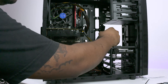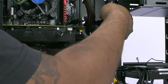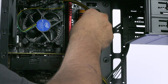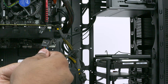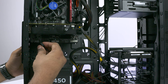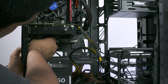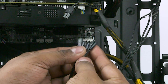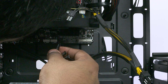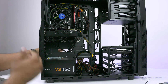We're going to connect the case cables now. First, the USB 3.0 cable — plug it into the USB 3.0 header on the motherboard, which is right below the 24-pin socket. Then plug the HD audio connector in. Next, we've got a bunch of smaller cables for power, reset, hard disk LED, and so on. Route them through the back — remember, the ones with the triangle are positive. You'll see the white header at the bottom that says F panel. It's quite self-explanatory: just read the markings and plug the cables in as mentioned.